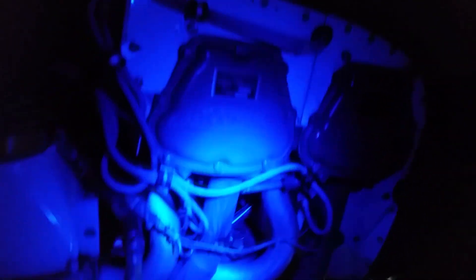You don't see any oil leaks right now, so let me show you what I'm looking for. I put a special fluorescent dye in the oil. See that orange? That's what an oil leak would look like — it would be obvious. So this is one way to help find oil leaks.